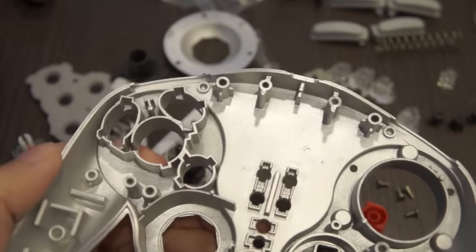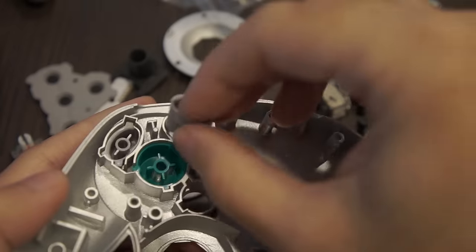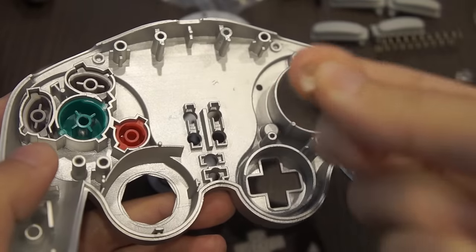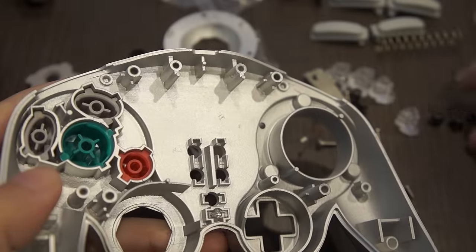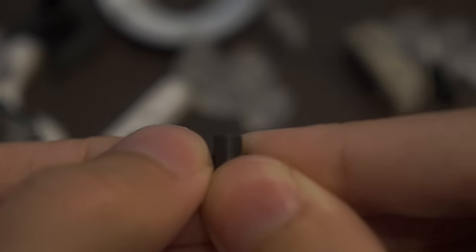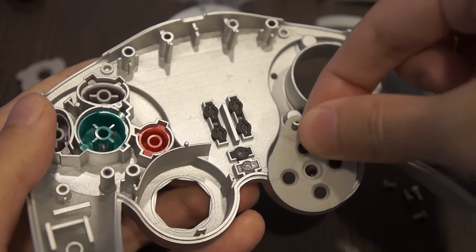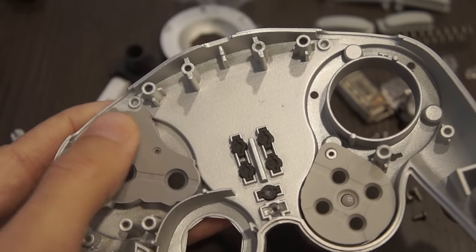For this build I'm going to be using original buttons just to show what that looks like, because original buttons are just drop-in as well. So if you've got buttons that you really like, those all just fit. There's a little light pipe piece here for the status LED that shows you the player number — that's more of a press fit. We've also got these menu buttons that are resin printed; they've got a nice incline to them which matches the incline of the top of the shell. All those buttons are in place and we can go ahead and put these membranes on — I'm using OEM membranes just to demonstrate that these original parts are a perfect fit.